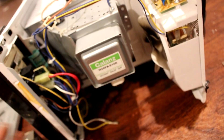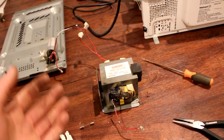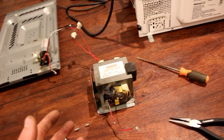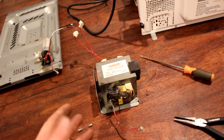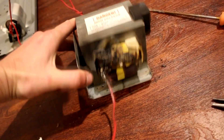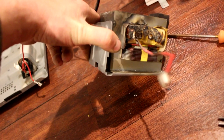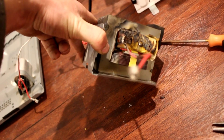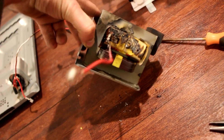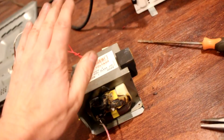I'm not entirely sure what would actually cause that. Obviously being in the low-pressure environment is what ultimately did it, but maybe it made it so arcs could jump over larger gaps and short it out. I totally fried that transformer, but other than that everything else looks pretty much okay — the fan got a little burnt, but the magnetron and everything else looks fine. The beepers unfortunately are just fine too. So this microwave is ultimately fine except for the transformer. I was not expecting it to die so quickly — I thought maybe since the fan couldn't blow air it would overheat, but this only lasted a few seconds. I've been wanting to look at electrical discharges in a near-vacuum environment, and I guess this gives me an excuse to look into how far an arc can jump in a near vacuum. I'm definitely going to look into this more. Until then, I'll see you next time.